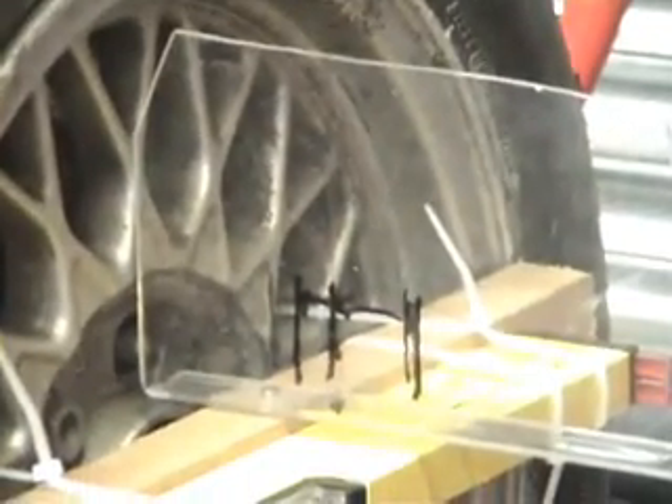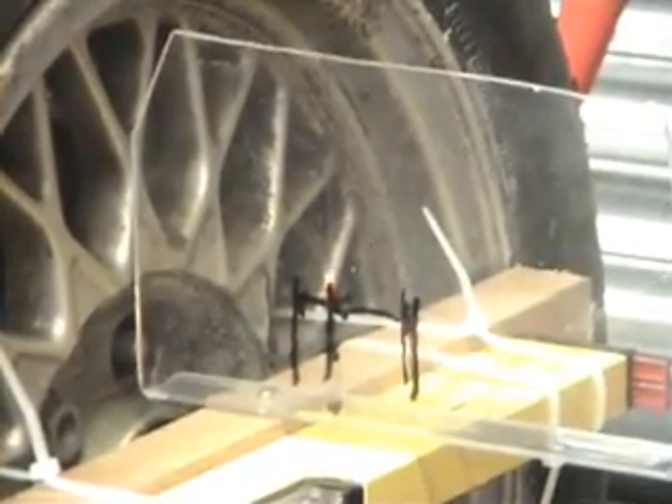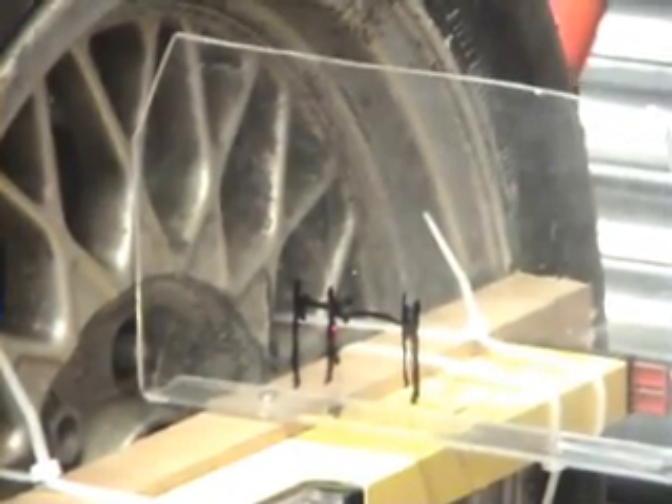It's just drifting off now. By the way, if you adjust the wheel round a little bit you can see the line moves up and down. It's just going off the line when we're going into full bump, and it's about 3mm off the line. What that actually means: 3mm divided by 10 — this is 0.3mm out, which is acceptable.